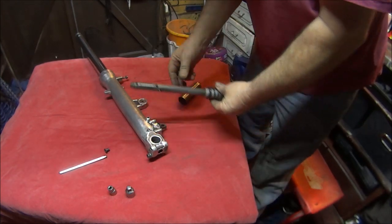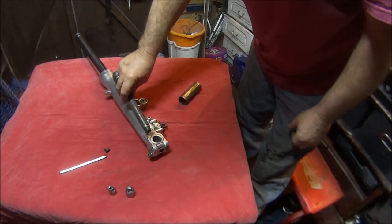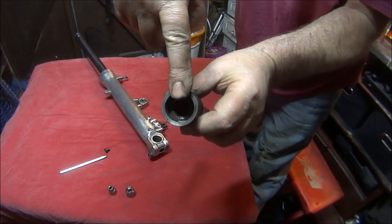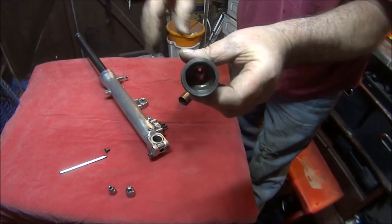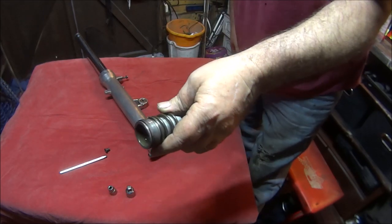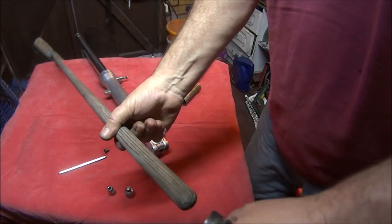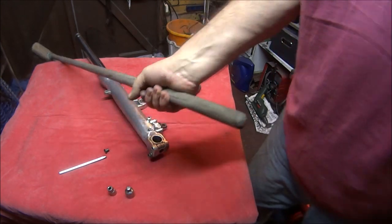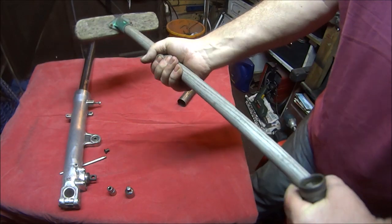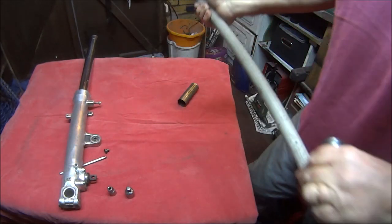So that's the damping rod, and that lives in there like that. That's where the little bolt screws into. Luckily this one came out nice and easy. But normally there's like a hexagon hole so you can fit some sort of box spanner or tool down there. This one's just got a round hole, so you have to get an old broomstick, get your Stanley knife, make it into a little bit of a point, and bash it in there with a hammer. When that's bashed in from the other end of the tube, you can get some grips on it and try to undo the bolt. I'm sure you all knew that anyway.